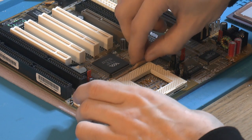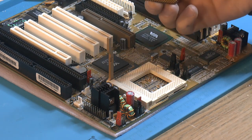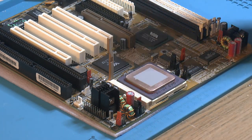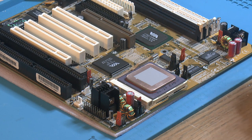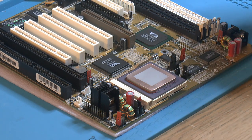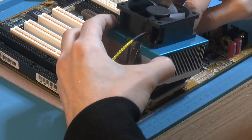Time to mount the CPU. I pre-applied some MX-4 thermal paste and used Kapton tape around it to get a good spread. Since this is the final mounting, I want the perfect amount — not too much, but spread out as much as possible without getting everywhere. The clamping pressure isn't as high with these old coolers as with modern ones, so I tend to run Prime 95 first before final mounting, so when the paste gets warm it squishes out and spreads better. That's why I did this fancy application this time around.